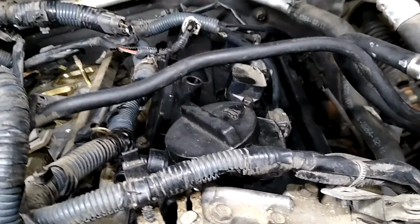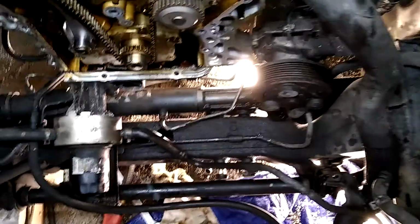All of this is done. So I'm going to pop the coils back off. We'll put new plugs in it. It's getting a new radiator put in it, because while I'm here, $100 for a new radiator. It's probably half-ass plugged up with 219,000 miles on it anyway. And then I'm going to flush and redo the air conditioning, because I put this condenser in 2 years ago down here. And for some reason we've got a slow leak somewhere.